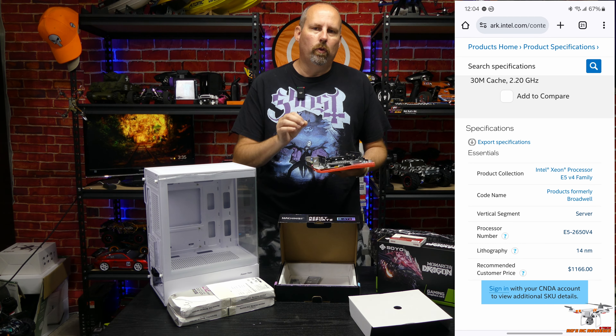For the SSD, we have a 256GB Besta M.2 Gen 3 NVMe drive for $18. That's not a lot of storage, but it'll be enough for Windows and a few games. You could easily add a 1TB SATA drive for around 30 bucks. If you buy an M.2 off AliExpress, make sure you look around — there are a lot of fake ones like counterfeit Samsungs. This one appears to be a legitimate, decent SSD.